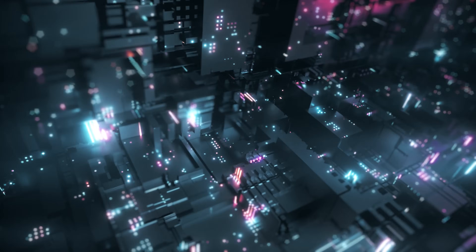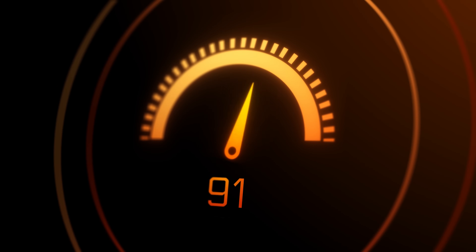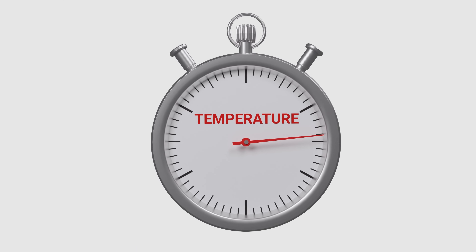The amount of electricity an SSD uses as it simultaneously reads and writes to its trillions of NAND flash cells at high speed generates significant amounts of waste heat. We just need a heatsink. SSDs will throttle their performance to protect their internal components — that's what happened when my friend started lagging earlier. This was caused by the SSD reaching a temperature outside the range for normal long-term operation. The good news is that there is built-in protection against frying your drive. The bad news is that your drive will underperform at times when you need it to do otherwise.